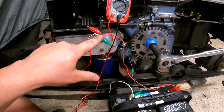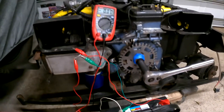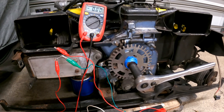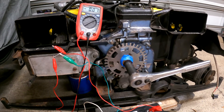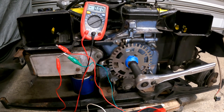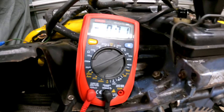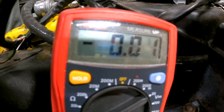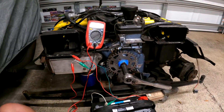I didn't take the plugs out — that was a bit lazy — but that's what we're looking for. Sensor hookup: red to hot, black to negative, white-and-black to your meter, meter grounded. Take your time to do this — in my car, if I didn't get this right before putting everything back together, the engine would have to come back out, which I definitely don't want. Going ahead now to button up the front of the engine, checking that everything clears and I'm getting the appropriate signal as I rotate the engine. Feeling pretty good about it. Cool setup, cool product from the Dub Shop.